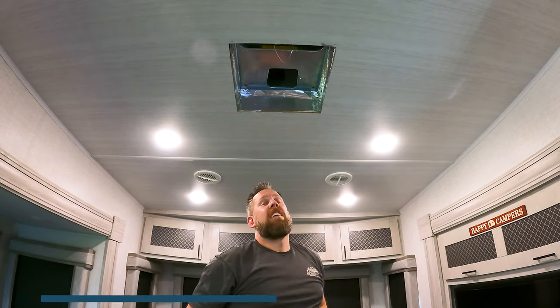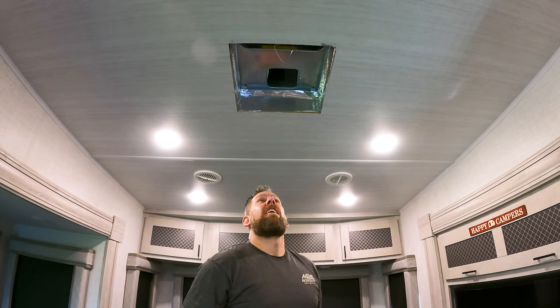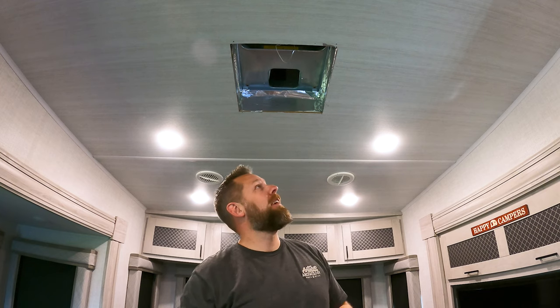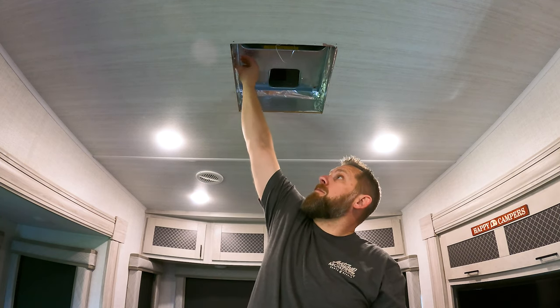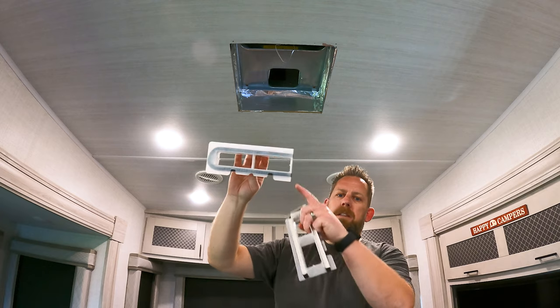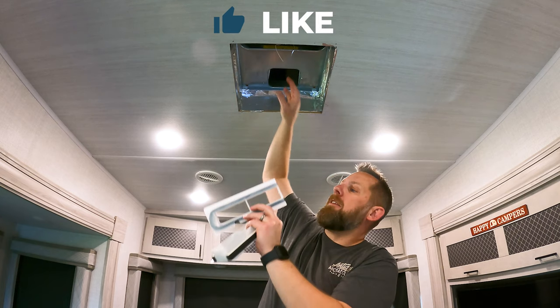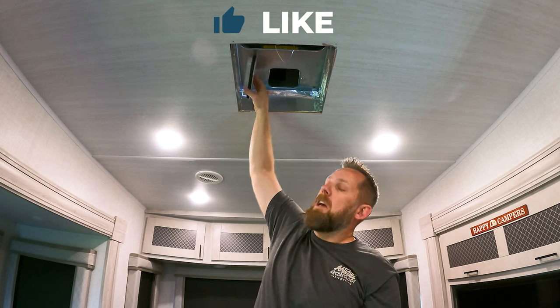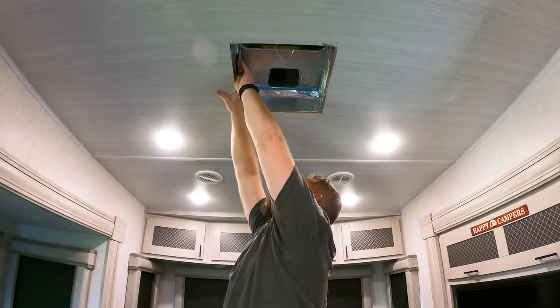One thing you probably want to do is have a second set of hands to hold the metal plate and be ready to catch the leg bolt. After that, your next step is going to be checking your ducts — what you're looking for is any loose foil or any duct inserts the manufacturer may have placed in there. Now we're going to insert our duct inserts into the ducts. The sheer side should face towards the back, away from your return. First, test-fit these before taking the adhesive tape off and make sure they fit inside your duct.